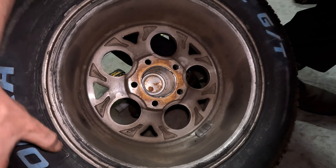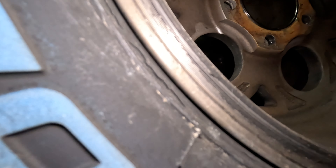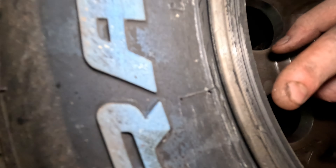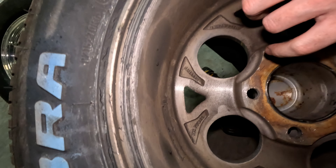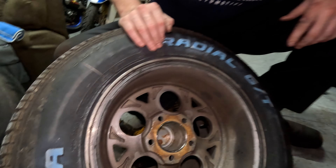I'm not really excited about that - these guys are about a year old and they're going to crack. Wrong offset - check this out, a little bit of rubbing. Had to fix that with a quarter inch spacer; it got into the control arm a little bit but that took care of it, though I'm not really a big fan of it.